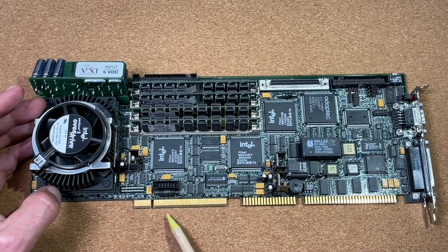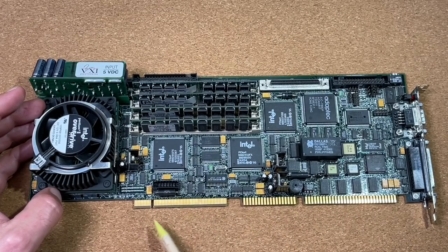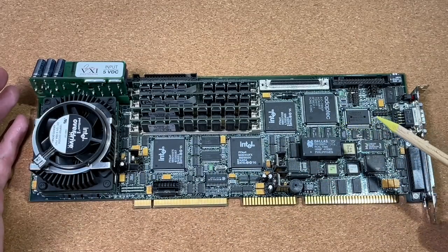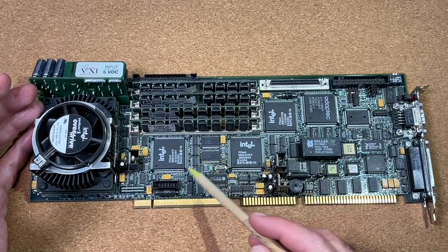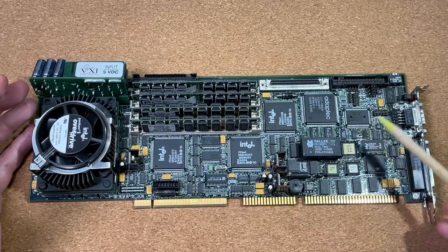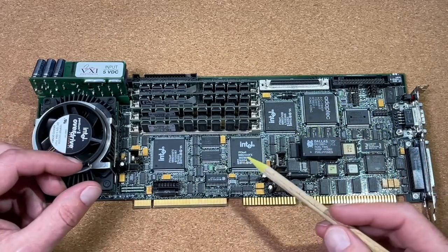Yeah, for the bus connection we can see here two different standards combined. First the 16-bit ISA connection and behind it the extension to the PCI bus. Obviously we are missing a video card here. On the board we have just the Intel 440FX chipset and the Adaptec controller. This means we need to add a proper video card later to our setup. Also keyboard, mouse and USB connections are missing, and I needed to improvise a little bit here.